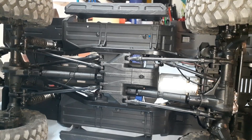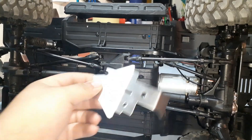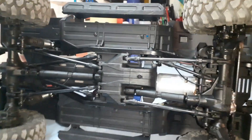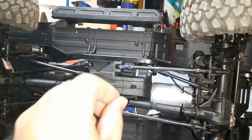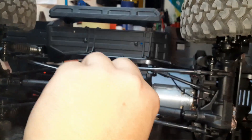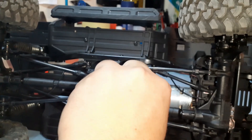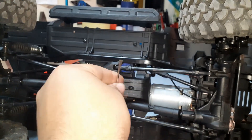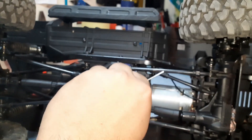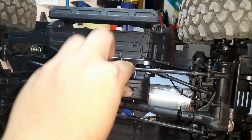We're going to start with the centerpiece, which goes right here on the transmission skid plate. There's a screw right here — just screw that out. You can use an impact gun or just an electric screwdriver. I'm going to be using this allen key. It's pretty tight, but let me get some leverage — there we go, it's broken loose. Just unscrew that all the way.